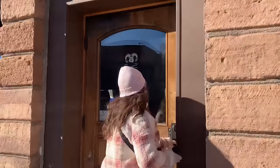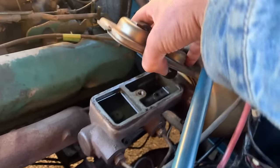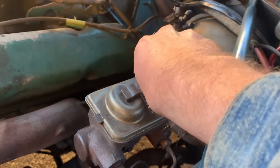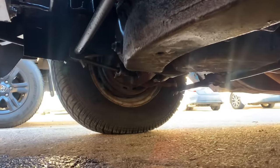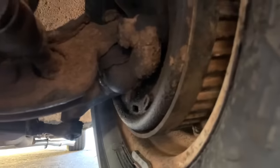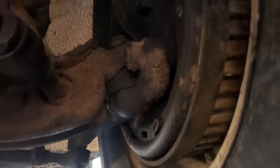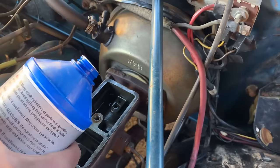I love restaurants in old cool historic buildings. My brake pedal started feeling kind of funky, so I took the cap off and we are dry back there — that's not good. Got to figure out where it's going. That side looks dry. It was the front reservoir, the one marked F. You can see it's damp around here, so I don't know if the wheel cylinder is leaking inside or it could be my brake hose — didn't tighten it tight enough. Could be leaking out of that copper washer. I gotta put fluid in it.